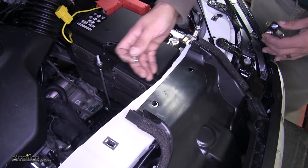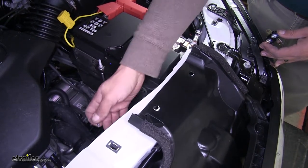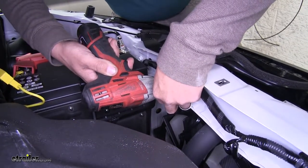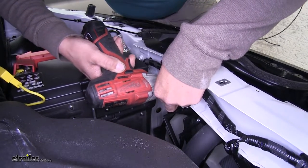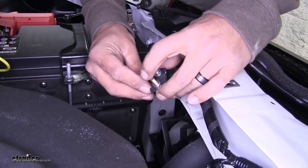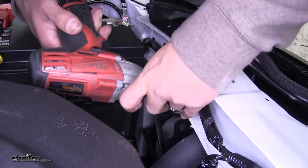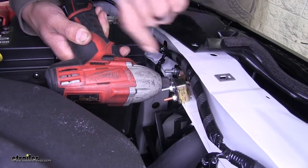Stay close to the battery side — don't go too much to the passenger side because you're going to have some radiator hoses you don't want getting in the way. Take one of the self-tapping screws and go right into the core support here. To make it a little bit easier in spacing our breakers, I'm actually going to use two of the mounting points on each one of the breakers as one, so I can take my self-tapping screw going through one breaker and then going through the other mounting point on the other side of the other breaker.